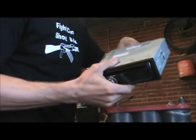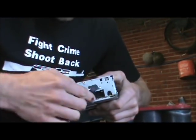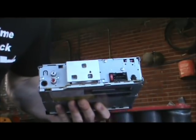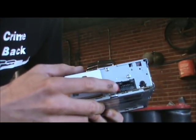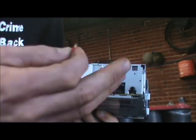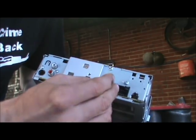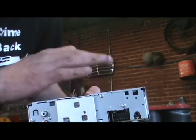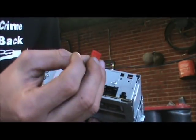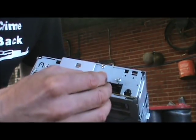All CD players have a fuse internal to the CD player. You see in the back of this unit — when you unplug it, there's a fuse right there. See that 10-amp fuse right there? All modern aftermarket CD players have a little fuse right here. If you cross the wires or something crazy happens, this fuse can get burnt up — that's its design. It's designed to burn up before your wires or the CD player itself gets hurt. It's kind of a fail-safe device. These are really cheap; you can get them from AutoZone, Walmart, gas stations — everybody sells them.